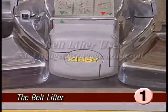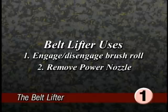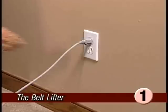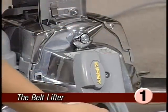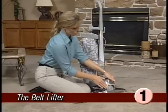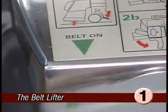The belt lifter on your Ultimate G serves two purposes. The first use is to engage or disengage the brush roll. The second use is to allow removal of the power nozzle when converting your Ultimate G for use with various attachments and optional accessories. To disengage the belt and prevent the brush roll from rotating, make sure the power nozzle is raised to its highest setting and the Ultimate G is unplugged. Raise the headlight hood, flip out the handle on the belt lifter, and turn the handle to the left or counter-clockwise until it stops and the red arrows line up. Return the handle to its closed position. Lower the headlight hood and your Ultimate G is ready for use as a straight suction cleaner. To re-engage the belt so the brush roll rotates, turn the belt lifter to the right or clockwise until the green arrows line up.